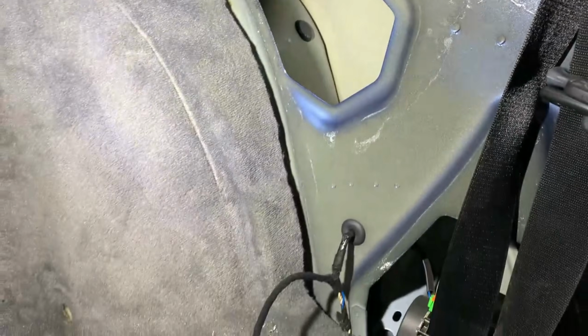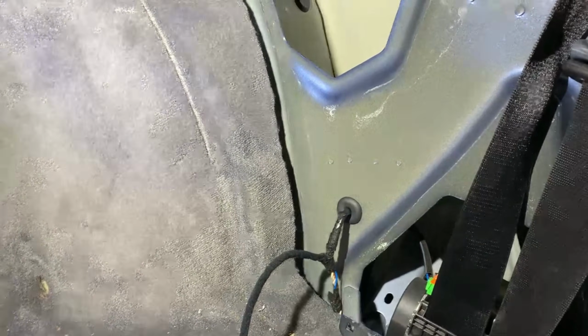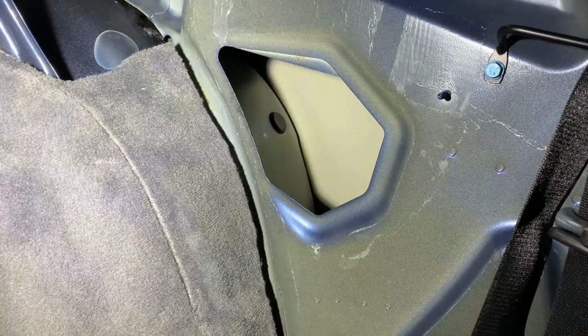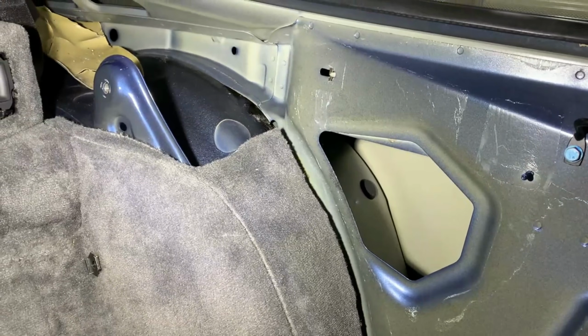It's pretty hard to pick out on the camera here, trying to balance everything, but just in there we can see there's some corrosion from the inside coming through, so we'll focus up there, and then further down the bottom as well. So now we've got all this out of the way, we've got nice clean access, and we know we've got nothing flammable in here. We can get the weld-through blankets in there, get it all protected and start cutting this out and getting some repairs in.